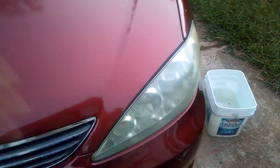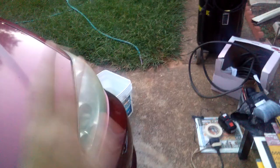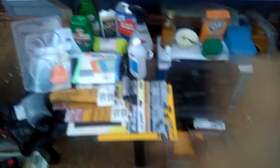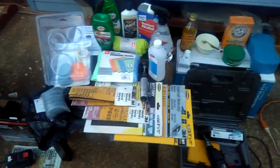Use your hand in a round circular motion first, then horizontal secondly. That's the technique everyone shows on YouTube — sand in a circle first, then horizontal, then back to a circle, then horizontal again. You just kind of switch over and over. But the very last thing you want to sand is horizontal. That is the method if you're going to spray UV clear coat on the headlights. If you don't spray UV clear coat, you can just sand in circular or horizontal motion — it doesn't really matter.